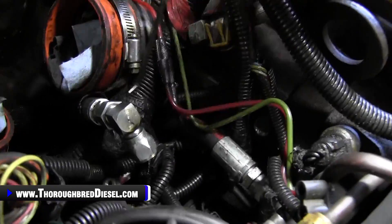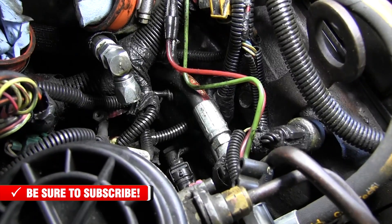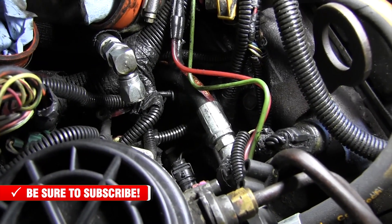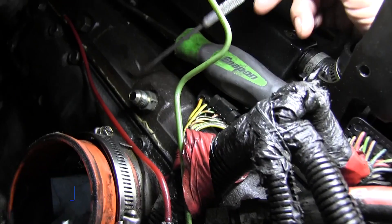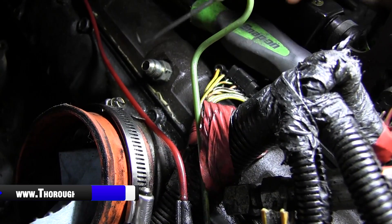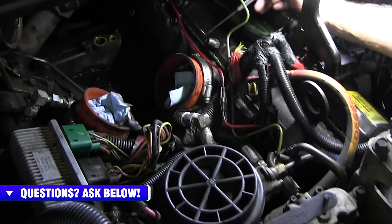Here at the front, your high pressure oil pump has got two lines that run out of it, and these lines run to each respective head. This line here is running to our driver's side head, and this line is running to our passenger side head. You can get some leakage at these lines — these are not factory lines; this is an upgraded line the previous owner used. What happens is you can get leakage between the fitting and the head or at the lines themselves. There's another set of feed ports back here — a lot of guys use dual feed lines. On most trucks it's going to be blocked off, but if you've got the dual feed lines and the crossover junction line, you can have leakage between the fitting or between the fitting and the factory oil line.